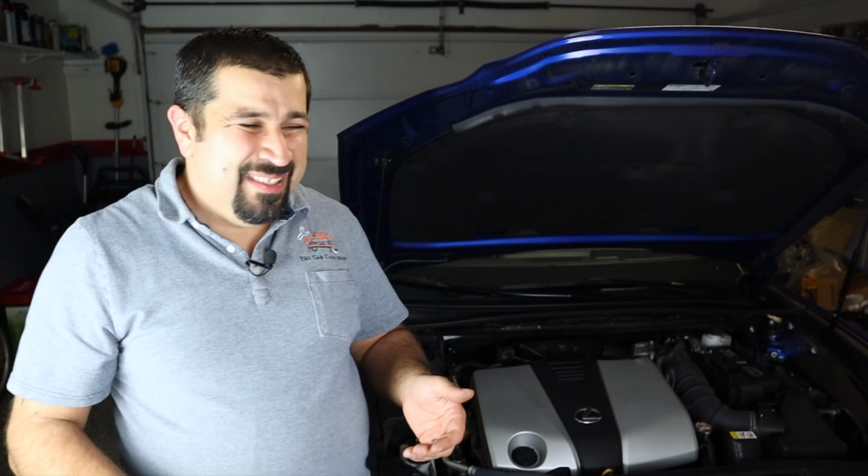If you don't have a garage, you park outside and there's a bunch of trees around you in the fall time, you got to be active on this. And if you really don't want to deal with all this cleaning and all this hassle, there's another solution. Cover your car when you let it sit under a tree if you have no other choice. If you have a choice, don't park it under the tree. If you don't, either be overactive on the cleaning or just cover it up. Fall is really only a month, maybe a month and a half. It's a hassle, but trust me, losing your car over a water intrusion because of a clogged sunroof drain is a lot worse.